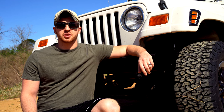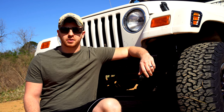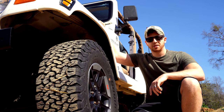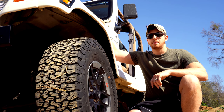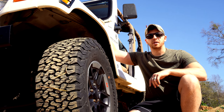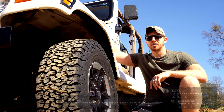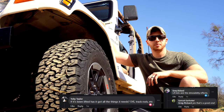You've probably heard a lot of people say owning a Jeep is a lifestyle, and that's true if it's your daily driver. Before you buy a Jeep, make sure you know what you want it to be used for - do you want it as a weekend cruiser, or stock so you can drive and get groceries with? It's beneficial to buy it set up the way you want instead of modifying it. My Jeep here has a two-inch suspension lift and a one-inch body lift, which allows you to clear tires about 33 inches. This is the in-between lifestyle - good for off-road with a little extra clearance but hasn't affected ride quality much. When you start lifting over four inches, a lot of geometry gets exponentially altered and a lot more modifications and money need to go into the Jeep to make it streetable.